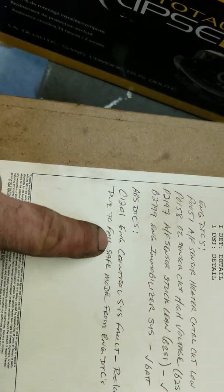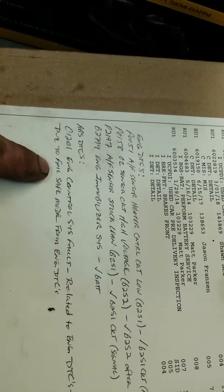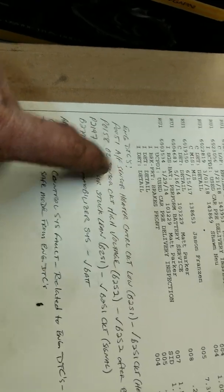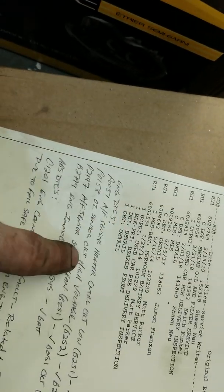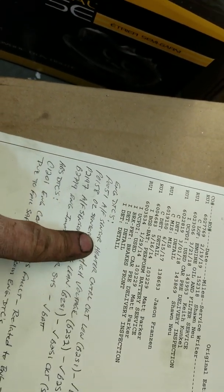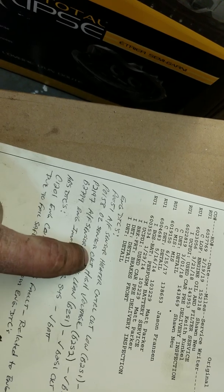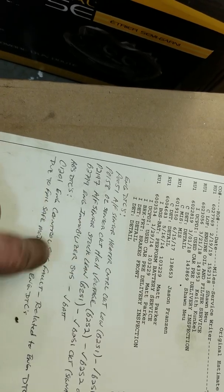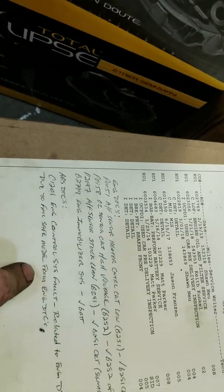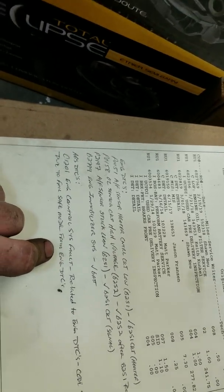On these Toyotas, when the engine sets these codes it goes into failsafe mode, and you can see in the ABS it stores an engine control system fault — C1201 — which is why the VSC light came on. We're going to put an upstream air fuel ratio sensor in on bank two, since we know that's faulty. I'll check the downstream O2 too, but I have a feeling it'll be just fine. If needed, I'll make a follow-up video. Thanks for watching!